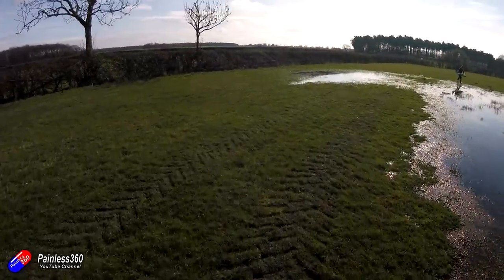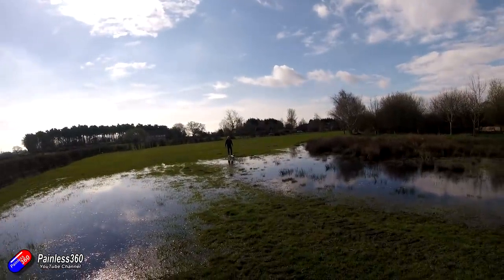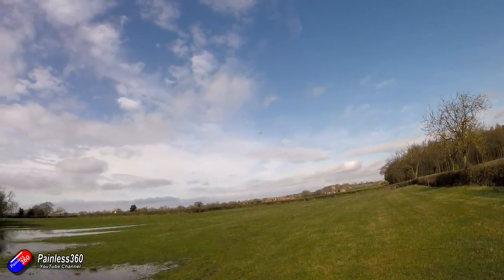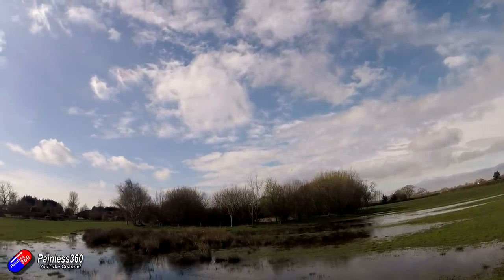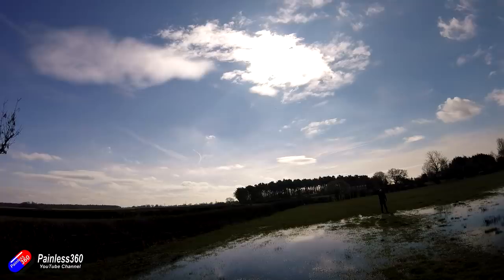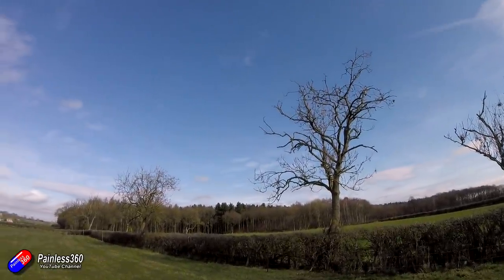We decided to do another taxi run to see how much power it had and how controllable it was in the water. The flaps weren't down, but I gave it a little bit of a go and it immediately wanted to take off. I gave it a little bit more power, had one little bounce, another bounce, and it was up. The only thing I had to do with the centre of gravity being about 80mm back from the leading edge was play with the elevator — it needed a little bit of trim as it wanted to go nose down. But once I got that trimmed in it was flying absolutely beautifully. The flying experience is very similar to if you've ever flown a Tundra or a Bush Mule. In the sunshine, those beautiful white and yellow decals and paint look absolutely fantastic.